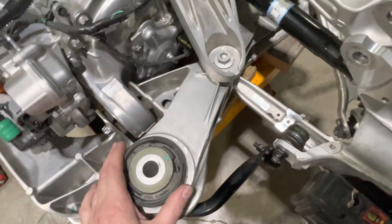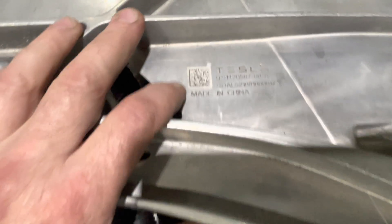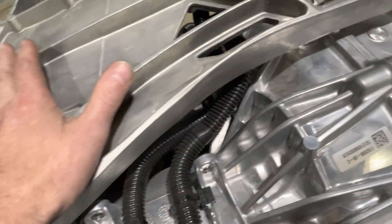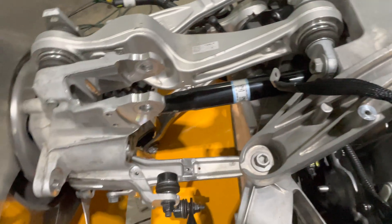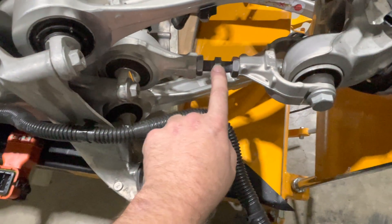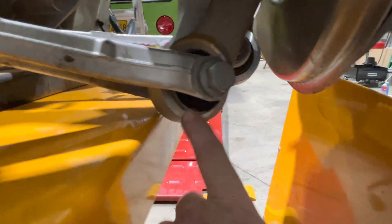We've got our sway bar under here. These are the four elastomeric mounts that tie the subframe into the body — there's one there, one there, one there, and one there. The castings are extremely high quality, hollow, and made in China, but I definitely haven't seen too many castings of this quality — they're really nice. The suspension arms are also very well done, very heavy, really nice forgings and castings. We've got adjustability here and then adjustability by eccentric bolts on the bottom of some of the arms.